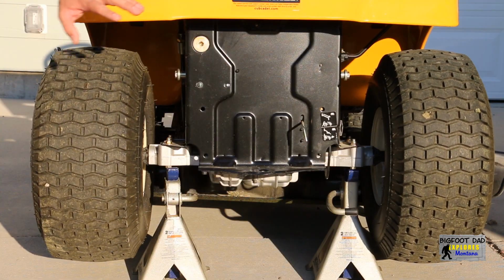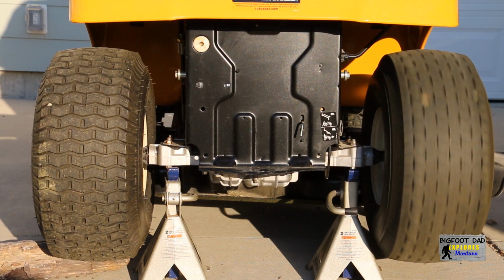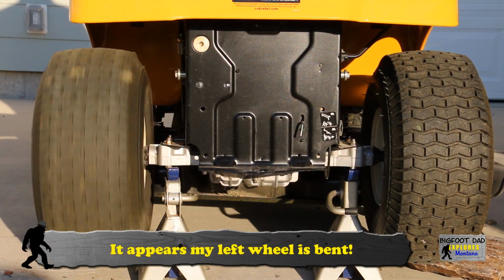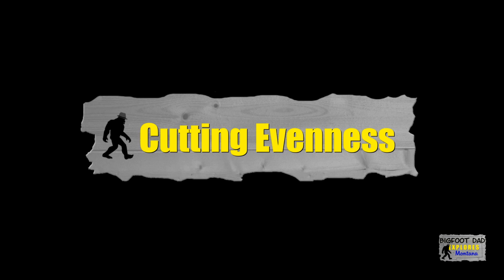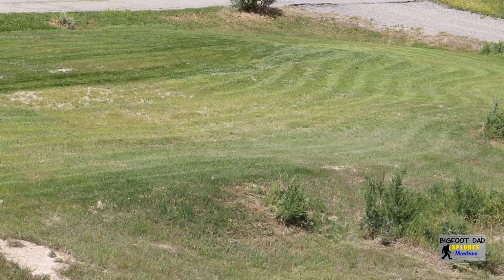With an open differential design, if there is equal load to both wheels, they both should turn at the same speed, as you can see here. However, if one wheel loses traction while the other wheel is firmly planted on the ground, the wheel with the least resistance will turn. Similarly, we can reverse this and get a mirrored result. In more expensive models, there is a differential lock feature which will lock the 2 axles together and eliminate this problem.